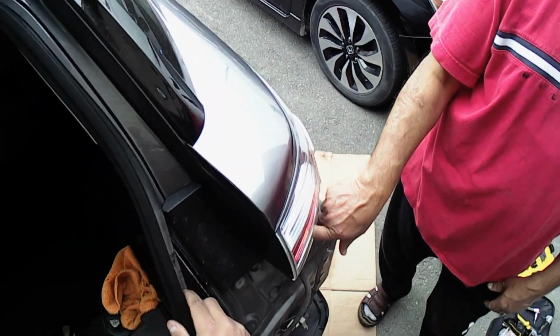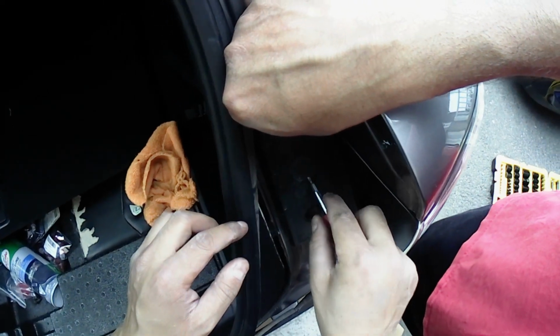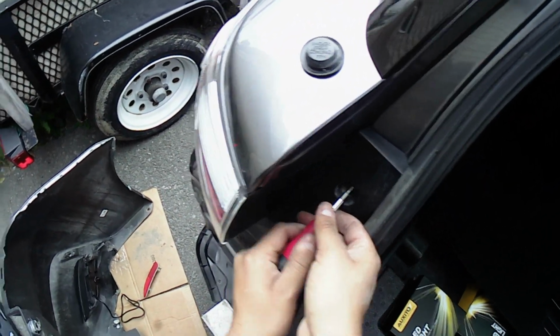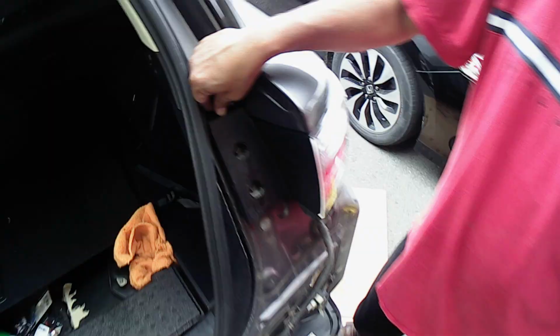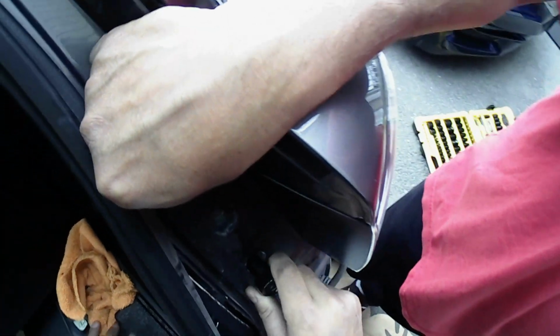Now it's time to wire it up to the rear lights. First thing to do is to remove the weather stripping and then pop the 2 plastic covers on either side to reveal the bolts. Remove the 10mm bolts holding the rear lights in place, and then just pull the whole assembly out. It will take considerable force.